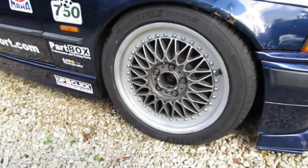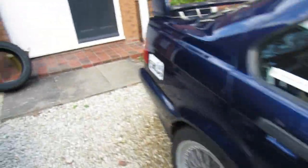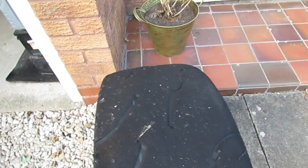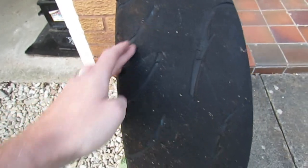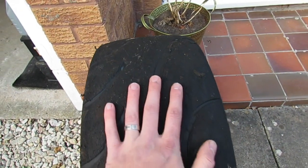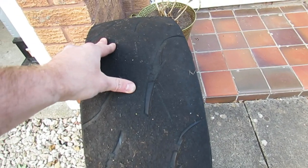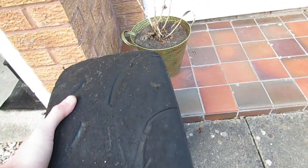The tyres fitted here are road-going tyres because the car is still driven to and from events. But for racing we use semi-slick tyres — this one is a pre-loved Nankang AR1, a very grippy tyre with very little tread, just small water-dispersing tread blocks. The reduced tread minimises tread block movement when cornering and reduces heat build-up. These run a very soft compound compared to road tyres, operating at higher temperatures and producing much more grip to improve cornering speeds.